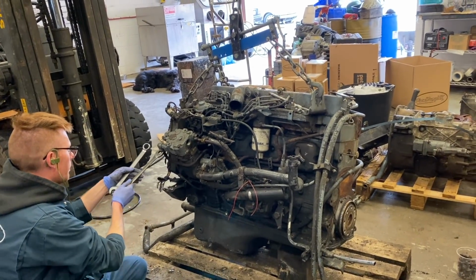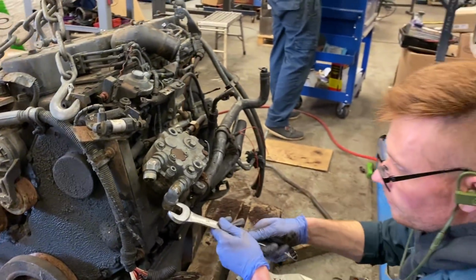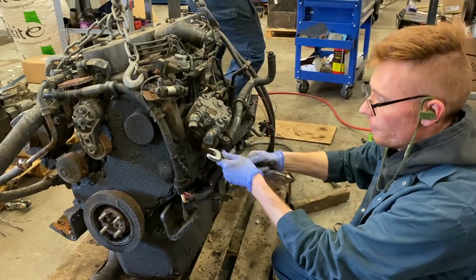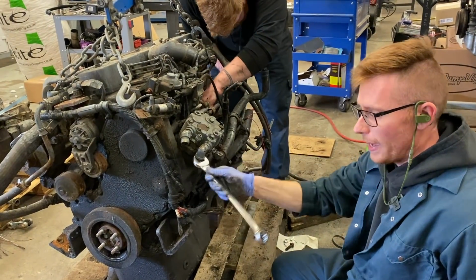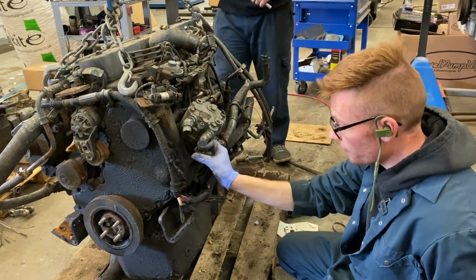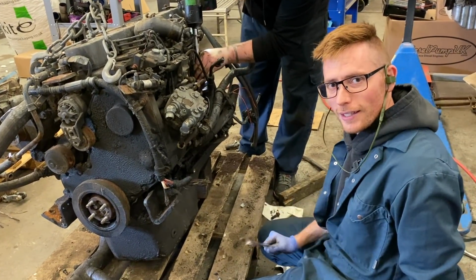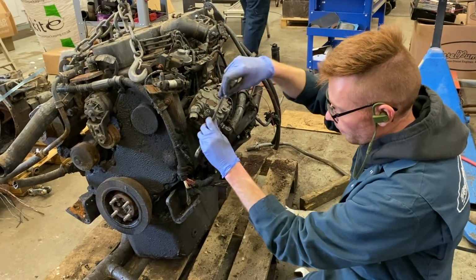Another coolant pipe for the air compressor. Good old Cummins and the coolant pipes. On a Volvo D12, the compressor water cooling has an actual rubber pipe that feeds it. Volvo, being Swedish and referred to as one of the best diesel engine manufacturers in the world, who I actually used to work for quite a long time, used to have said water pipes going into the compressor fail on a regular basis. Whereas the Americans, they obviously went, let's use steel, and it worked. And obviously they didn't have the same issue, did they? Theirs probably rusted rather than burst.